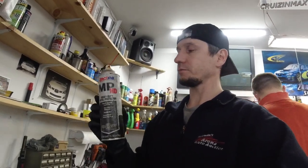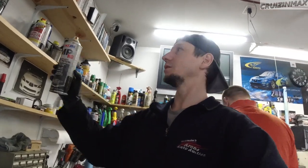I also sprayed the whole car, my Toyota, with this wax spray kind of deal. Say hi to Lucas. There's wool wax and there's something else. But this is supposed to be the best: every 5 years of maintenance, 3 to 5 years depending on where you are. Wool wax is every 1 or 2 years, and there's the one other, fluid film. Fluid film is a yearly respray.